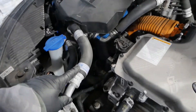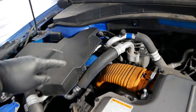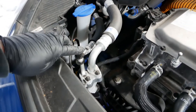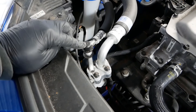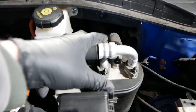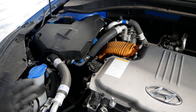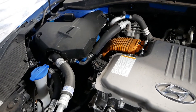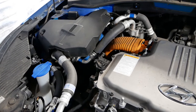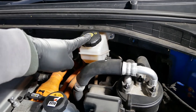All the other hoses here are the air conditioning. There's a unit under there — here's the low pressure connection line in the air conditioning and the high pressure connection point, with hoses at the back. All of this is your air conditioning unit and the heat pump. All UK Hyundai Ionics have a heat pump — they don't have a resistive heater like some Ionics in other markets.